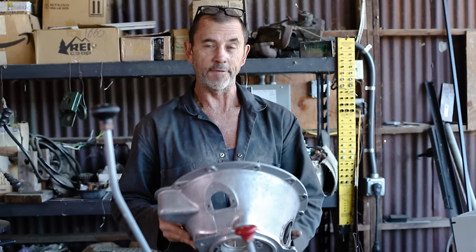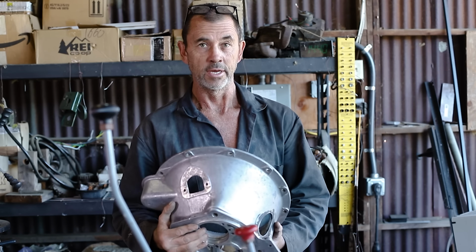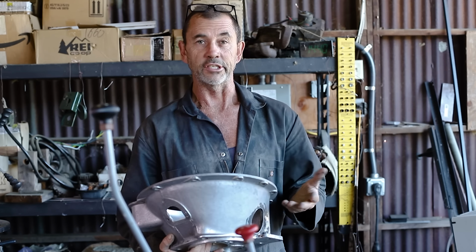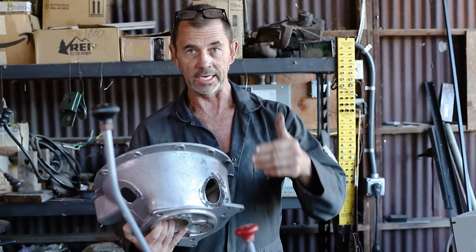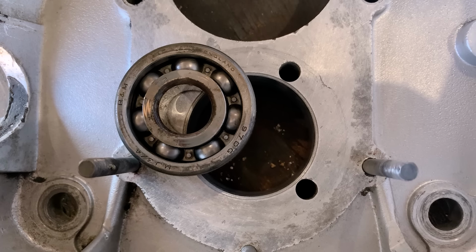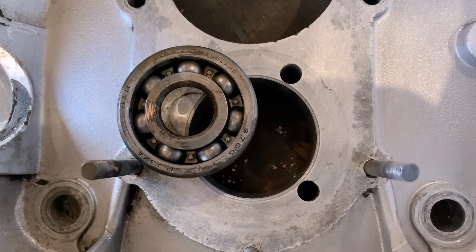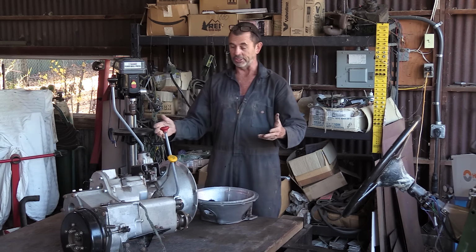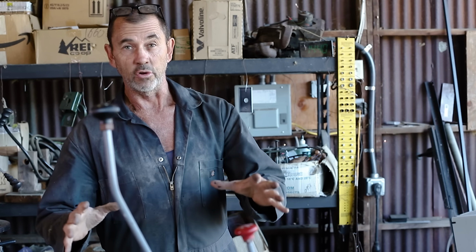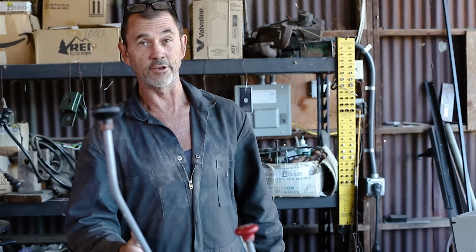And this may come off an early Series 2. Because in addition to the differing stud patterns, we also have the hole still there for the mechanical shaft driven clutch, but also the lay shaft bearing is the same as the original. For later on, Land Rover beefed it up a bit and that changed. However, despite all of our hard work, we're gonna have to go through, swap it out.